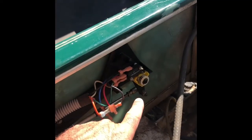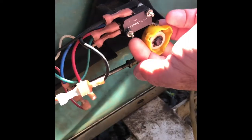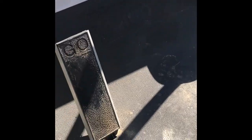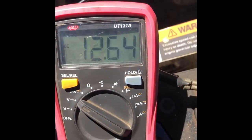With little Club Cars there's a way to put them in service mode. Pull this gear out, turn it over, and now you'll find that even in neutral it'll want to fire. So watch your voltage when you depress the throttle.